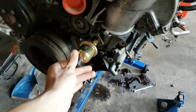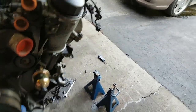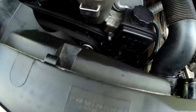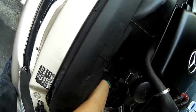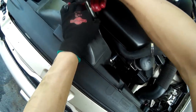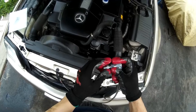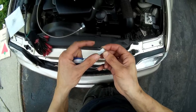Now doing it on the SL, which is slightly more difficult due to the confined engine bay. The only thing I had to remove was a radiator hose that was in the way - I didn't even have to take the engine cover off. After that I unbolted the plug in the engine and plugged the adapter in, then torqued it down. There's no torque specification in the instructions - they just say turn it until the copper washer squeezes, so use common sense. Since my sensor couldn't fit due to the fan shroud, I had to use the extra oil hose.